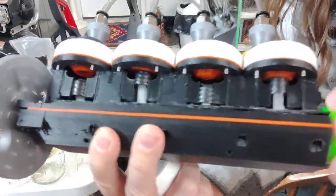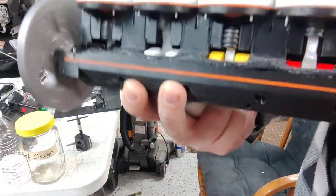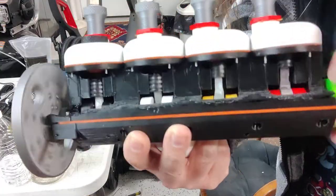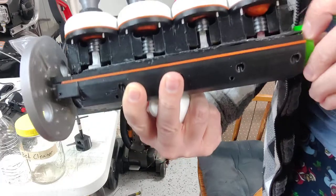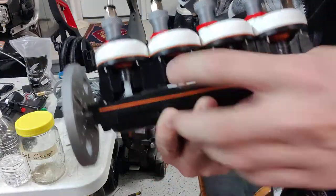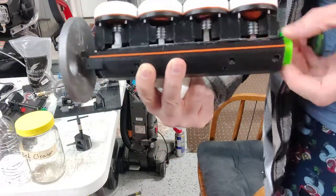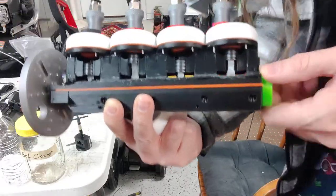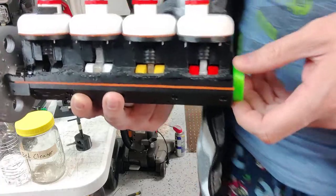The reason why I'm doing a cutout block is because the timing on this engine is seriously messed up. I don't know what the difference is between my mock-up, my rigging, and Blender versus the actual real-life final product — still trying to figure that out. I did find out that the crankshafts were off, offset just a tiny bit. I fixed that, but it's still not the right timing. I think the same problem is on the camshaft as well, inherently, so we have to fix that.